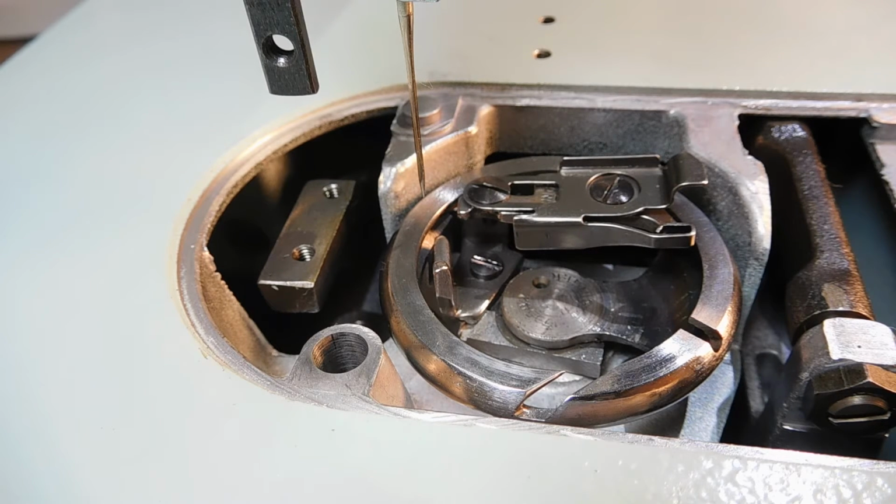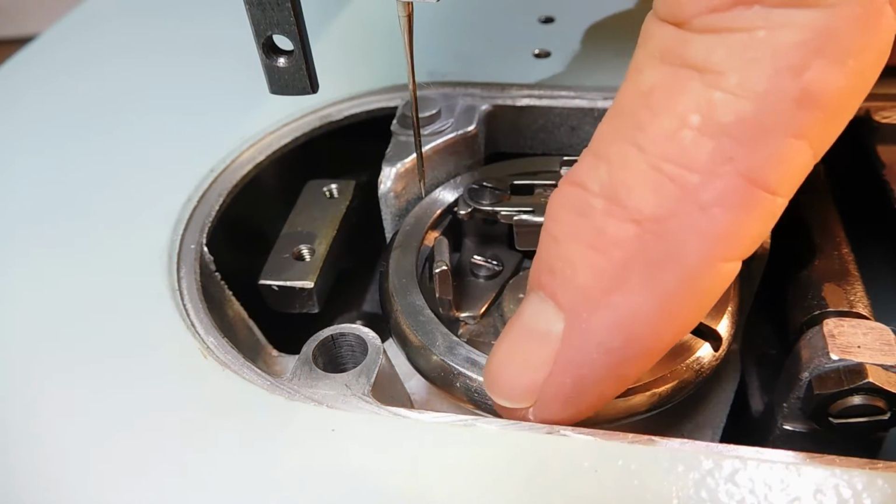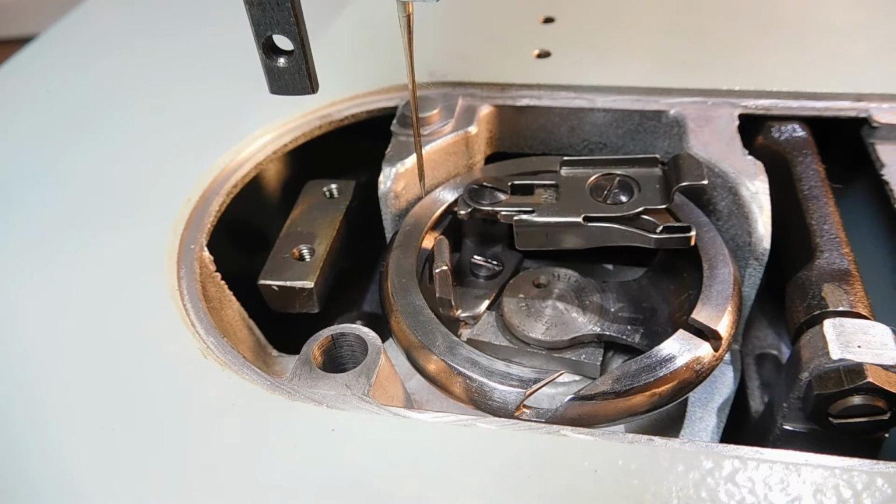But I've had probably, in my experience, about a dozen with small little nicks or burrs there, and the sandpaper has worked. Some took 50 little strokes back and forth. A couple took 200 or 300. But if you just do it evenly, and like I said, slowly work it towards that point, so kind of bring it off the same way the thread's going to go, then my hook point is good.